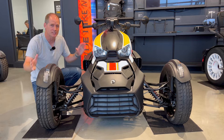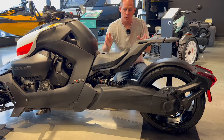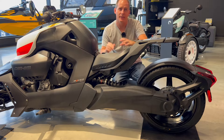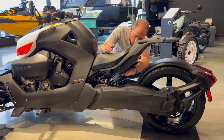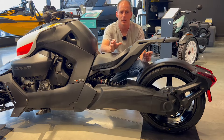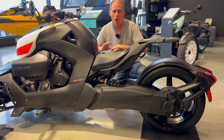Let's ignore the front half and take a look at just the back half. You have your suspension in here, and there is actually some rear suspension adjustment — that's going to be important as you start adding passengers or weight on the back. What's cool is you can see all of this open space, this long swing arm. It looks very futuristic. What that does is move all the weight forward and keeps not a lot of weight back here. That centralizes the weight — it's all about handling. A lot of people think these were designed for stability, but really it's the weight forward, centralized between the wheels and down low.